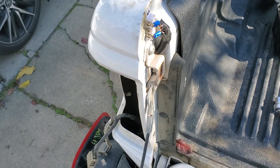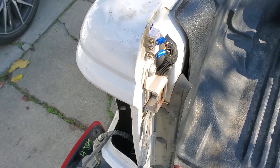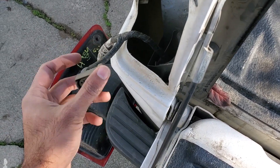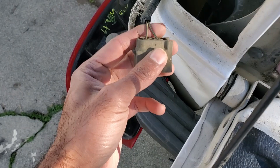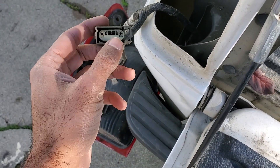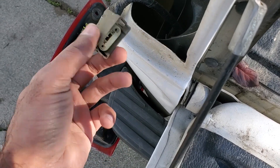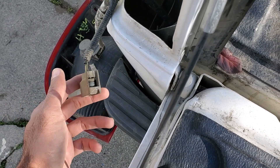This is the only Ford Ranger in the world with a tailgate ajar sensor — I'll link that video in the description. Anyways, I got the back light open here and I just unhooked the reverse light. Now I just have to figure out which one is positive and which one is negative, because that's important when hooking this up for power. One of these wires is brown and yellow, and the other is black and yellow. We're going to use a multimeter, stick the probes in here, and have somebody put the car into reverse — not taking their foot off the brakes — and that should tell me which wire is positive and negative.